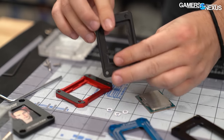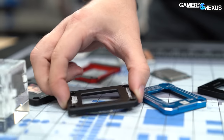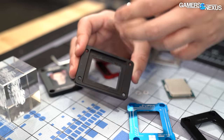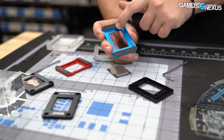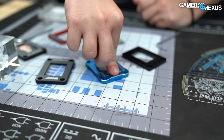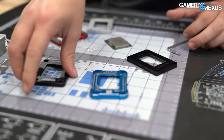Looking at the backside of the Thermal Grizzly frame, it doesn't have any pads around the border, so it actually floats a little over the CPU socket. The torque of those screws matters a lot because it's not supposed to make contact — if the frame makes contact, it will be over-tightened and your system is unlikely to boot. With the Thermal Right frame, they've attached a plastic buffer that rests on the surface of the motherboard. It's a relatively non-deformable surface, so it won't conform under pressure, and provides clean resistance across two contact points. That means you can tighten the screws all the way without worrying about the torque management required with Thermal Grizzly.